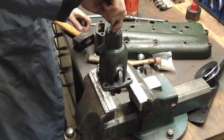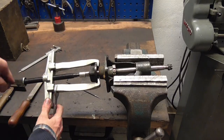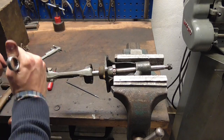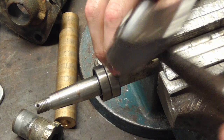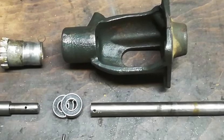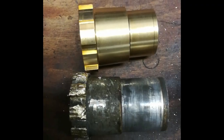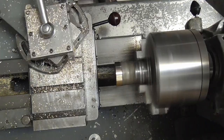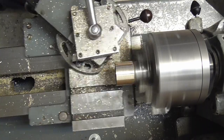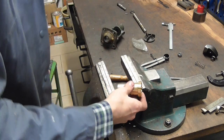More or less by accident I discovered how the whole thing was put together. The shaft is actually two pieces pinned together, and by pulling off the impeller you can get access to the split pin. The whole thing must be an early attempt at a leakless water pump because the new packing nut needle bearing doesn't actually fit. Luckily, the old one had the dimensions needed to make a bushing, and then I could reassemble it in reverse order.